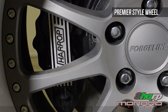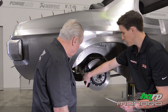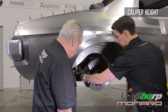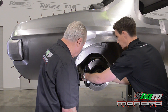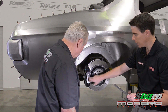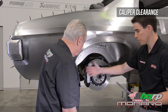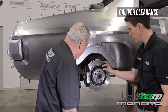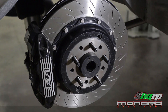As we've seen on the HQ, Peter's got this brilliant deep dish wheel with a fantastic finish on the rim shell, which makes that real muscle car look stand out. We'd want to measure the distance on the outside to see how much envelope we've got in terms of the actual wheel size — and that's pretty much exactly 200 millimetres. The other critical element is this overhang of the caliper. We want the caliper as close to the spokes as possible. In Peter's case, that's only 15 millimetres. These Harrop brakes have what we call a really shallow offset, offset here with a disc adapter using the park drum on the inside.